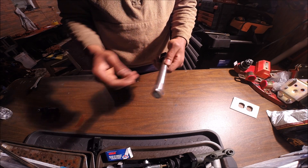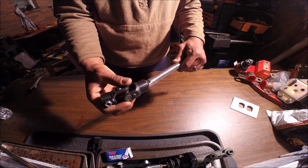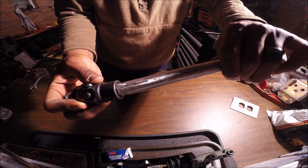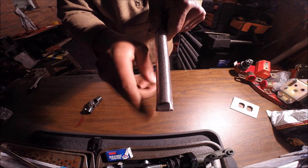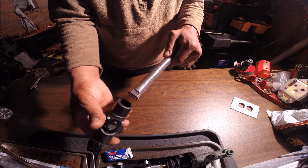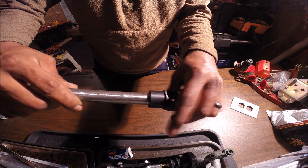At this point we're going to go ahead and do a test fit, because the new U-joint is going to go on this portion here. As you can see, it doesn't exactly slide on — it flares out just a little bit on the edges. So we're just going to go down and shave that down to make it slide directly in. And just like magic, it's shaved down and now fitting.